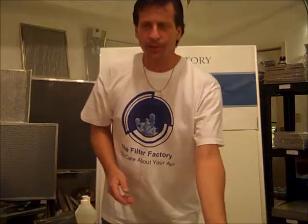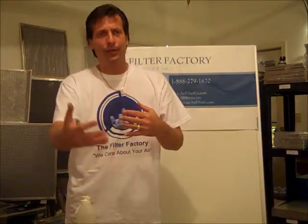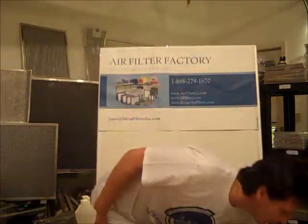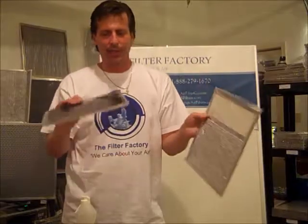As far as the carbon filters go, that depends on the environment of your household. Those filters are for hoods that recirculate back into the home. The consequences of not using carbon in that instance would be that odors and smoke would come back into your home. The activated carbon knocks that down or knocks it out in plenty of instances. It also captures grease — that carbon fiber media. So if you could envision this particular filter with carbon on one side, this side would face up towards the fan, and the other side acts as a grease catcher.